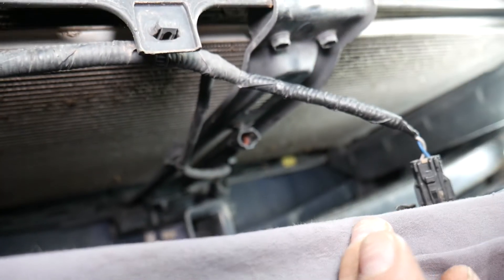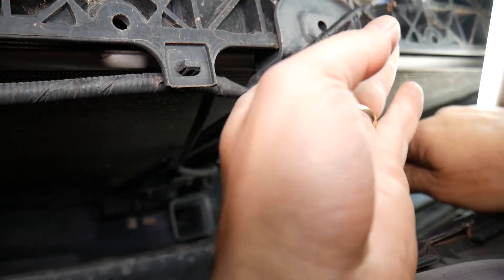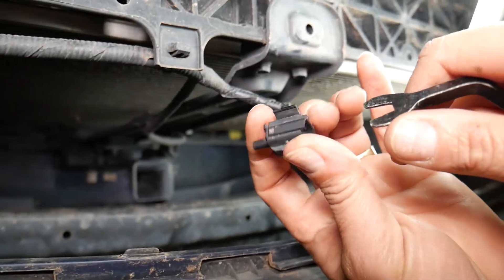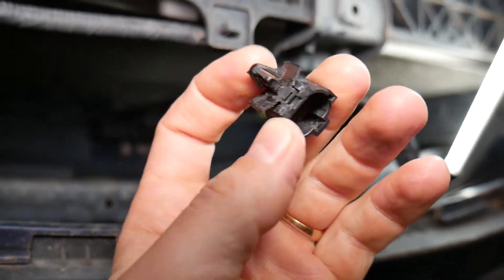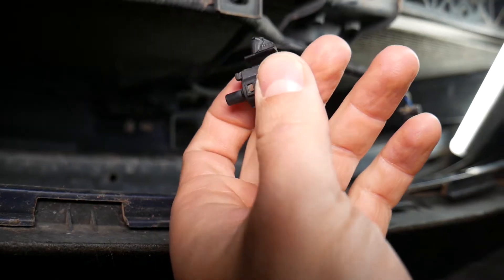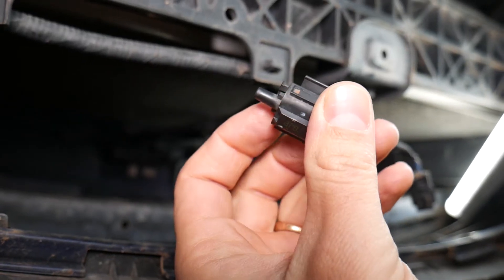You have to make sure it's plugged in, make sure the wire is not broken, disconnected, or contaminated. That could happen if you hit a snow drift or anything like that — you can break the wire sometimes. This is the sensor right here. You just use a plastic clip prying tool to pull it out. This is the sensor itself. If you need to replace it on a Kia vehicle, I'll try to put the link in the description below where you can get it from.